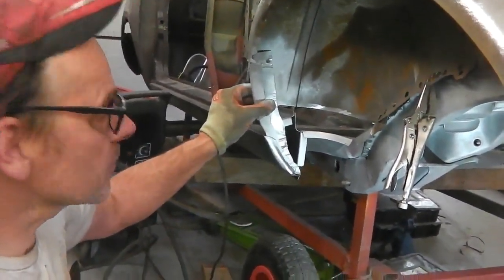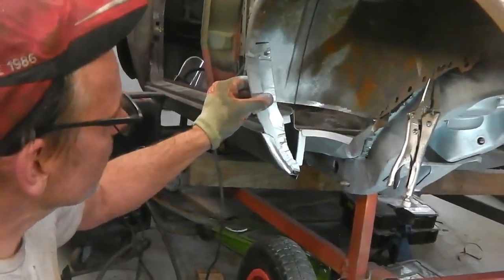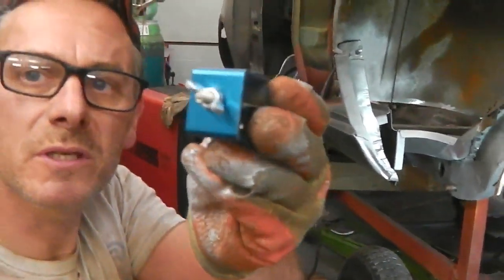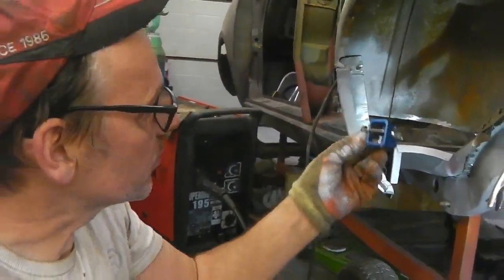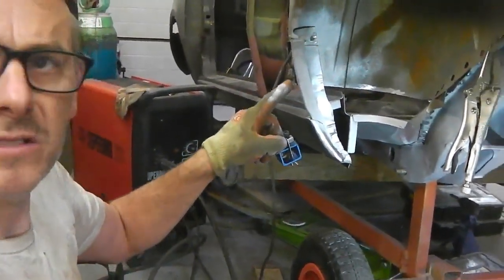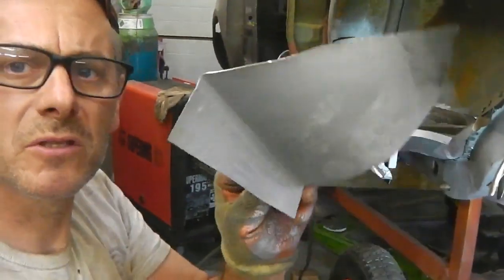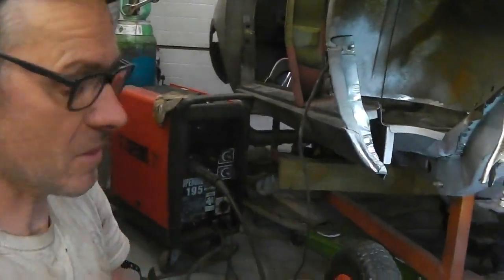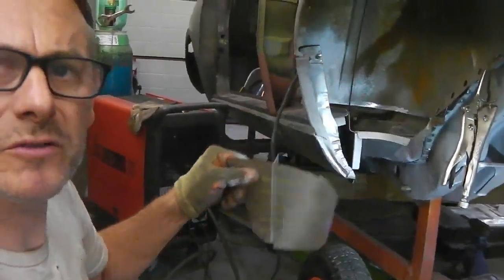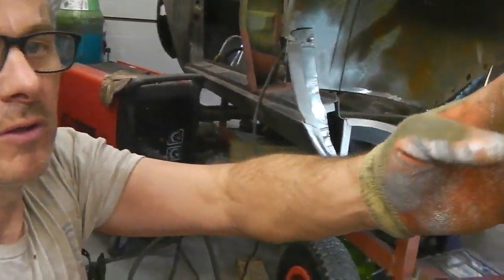This needs to go in there and get welded now. The welder's going to get ready any second. And once we get that welded, we get the clamps on. Here's our friends, the butt clamps. We put them down that little edge just to help us. We'll weld this section in, and then our super duper other piece that we've made, that then goes into there, and we've salvaged the wheel housing. And all we've got to do then is work our way to the back